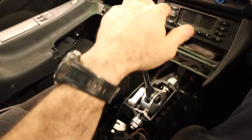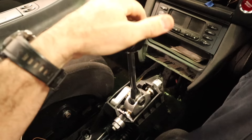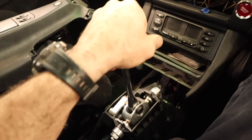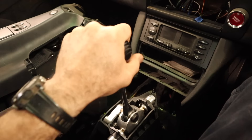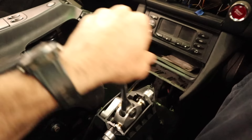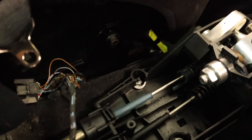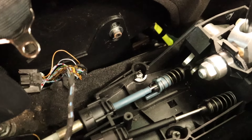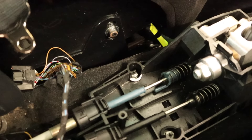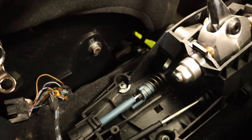The next thing I need to tackle is my gear shift. If you watched the previous video, you will have seen that I really struggled getting second to third, because the shifter at the moment is really good forward and backwards - it's nice and tight - but it's got so much slop in the lateral movement. And that comes down to this blue cable here, which I think is not functioning correctly on the gearbox end. So let's go and investigate that.